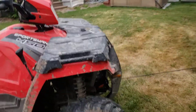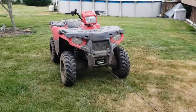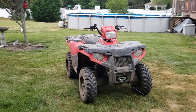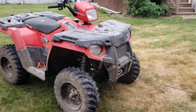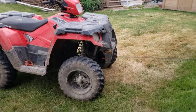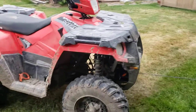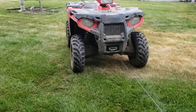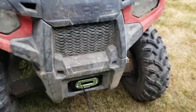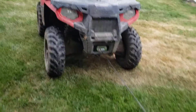As of right now, since it hasn't broken yet, compared to the Harbor Freight I'm liking this one better. Again, this one's nylon, 3,500 pounds, made by Zeak, Z-E-A-K. Had to make a couple of slight modifications to the box that it mounts in on the Polaris 450 HO — just had to elongate the holes for the front Zeak plate, which I had to do for the Harbor Freight one anyway, so no big deal.